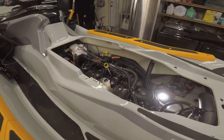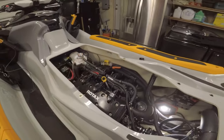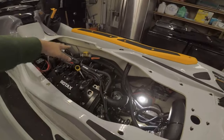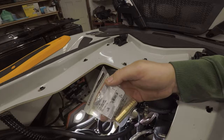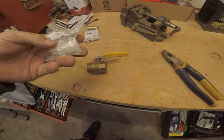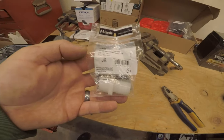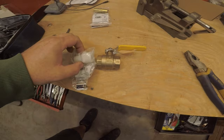I removed the direct connection and I'm adding a three-quarter inch ID, seven-eighths OD heater hose from the hardware store, rerouting it through a valve. This is for go mode and this is for towing mode, so the water's not going into your engine. I wanted the valve positioned up here so when the platform deck is installed I can take the seat off and switch to towing mode. If yours is straight to the engine, you can buy a three-quarter inch barb union, cut the hose, and reroute with a ball valve to stop water from going in.